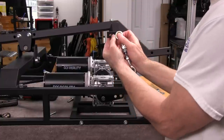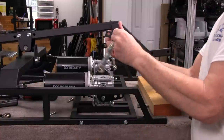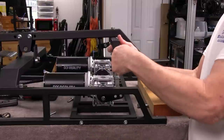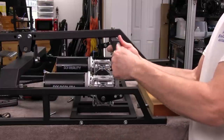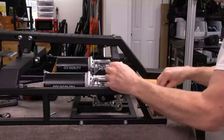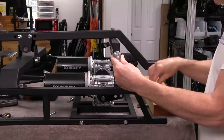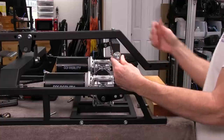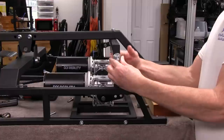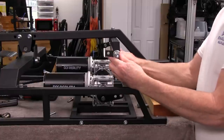and the bracket hole will be sticking out towards the rear there, like that. Go ahead and slide everything in. And the hole on this bracket here is also pretty tight. Might be this powder coating they're using, but you can see I can kind of screw it and it goes right in. Okay. So then we'll go on to the other side just like we normally would do and put our washer, a spring lock nut on, and this is kind of like a double lock thing, and of course our nylon safety nut, which is a 17 mil. And we'll secure it that way. Of course, we'll rotate our bracket back towards the rear, make sure that stays where it's supposed to.